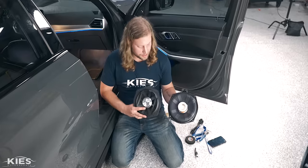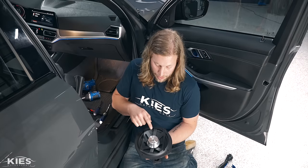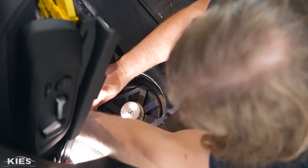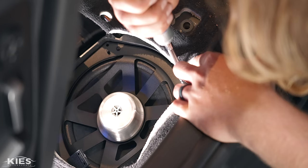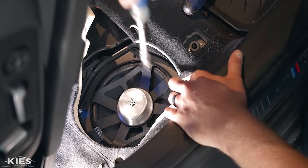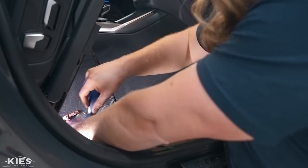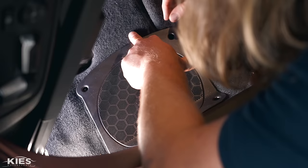Here's a side-by-side of the OEM Harman subwoofer and the Beamer Tech. To install, remember your plug goes in the back — slide it in, then reinstall your screws. I'd recommend tightening like lug nuts: put one in, don't fully tighten, go across, then go across again so everything pulls down evenly, then final tighten. There's no real torque spec — just make sure it's nice and even and snug, otherwise you will get rattles. Once that's done, reinstall the little grate.